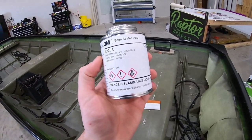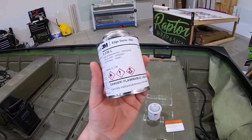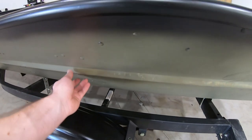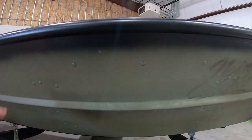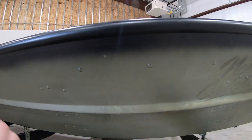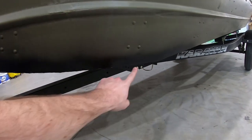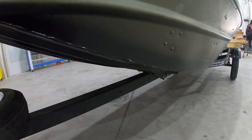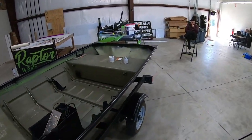The second thing you're going to need is edge sealer 3950. Basically, it's like a clear sealer. All your hard edges — around the sides, the back of your transom, the bottom of the boat — you can run that to lock it in. You can also use a bead of silicone, but we're just going to use the edge sealer. Make sure you seal and prime all of these edges really, really generously along the front edge because that's where it's going to take the brunt of the water. If you don't do that, you're probably going to get your wrap peeling off, probably on the first outing.